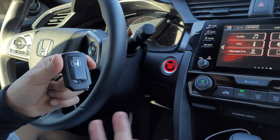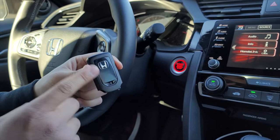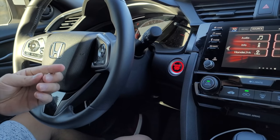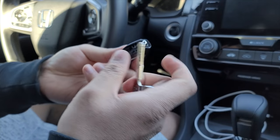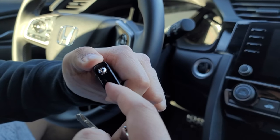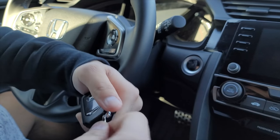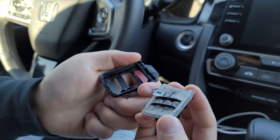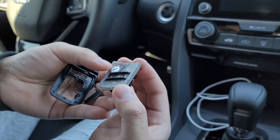It's kind of like NFC technology — you place the tag near the reader and it automatically detects what it is. That's essentially what's happening with this key fob. Now that you've started the car without the battery, you can drive just like normal. To replace the battery: insert the key into the slot on the fob and twist it until it opens. You can completely take the key fob apart and change all your buttons. We're going to go ahead and place the battery back in.